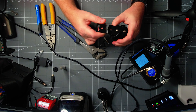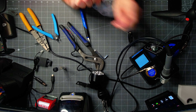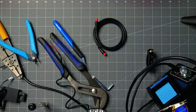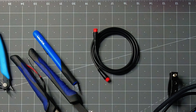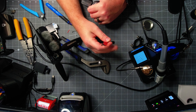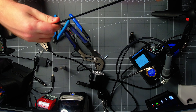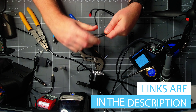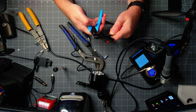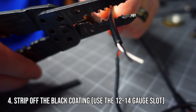It runs off the battery of the bike and you don't have to worry about any batteries being recharged except the bike battery. You're going to need a plug and this is going to plug directly into the factory plug. Now we need the male end. You can either take the one off your Rad Power headlight and cut that, or you can go buy one — that way you still have the original if you ever want to go back. I decided to get an extra cable; I'll be able to use two because it's male to male, but really we only need one. We're just going to cut it in half and use one side.